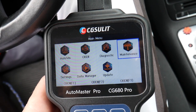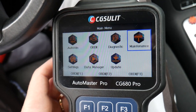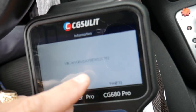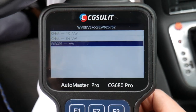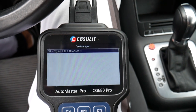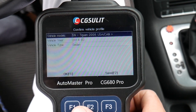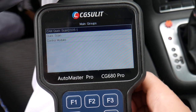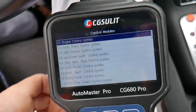You should check the manual and website — some special functions are not available for every single vehicle. But if you go into diagnostics, you can access every single computer in your car. It's going to read the VIN number and you can read fault codes and see live data with absolutely no problem. It's Volkswagen Europe — not a China-brand tool. We select the vehicle, it logs in, and we find the 2014 US Tiguan. Now you can go to diagnostics and do a quick scan or select a specific control module.